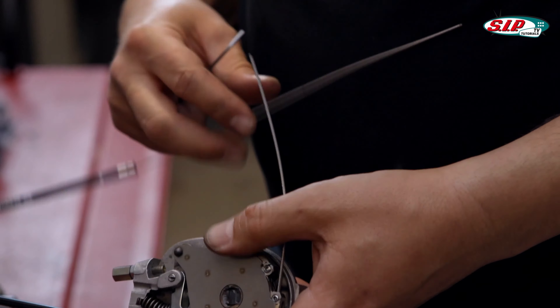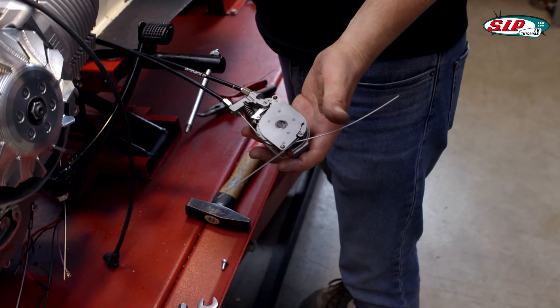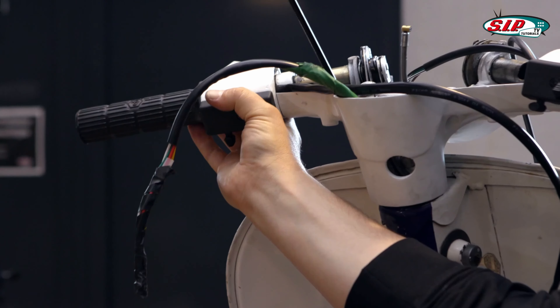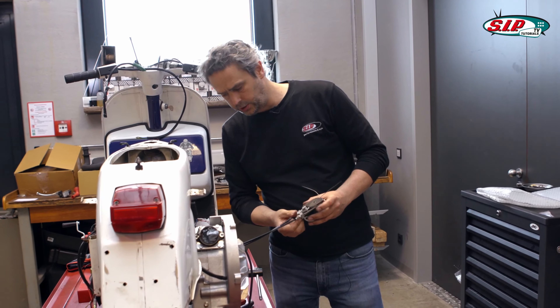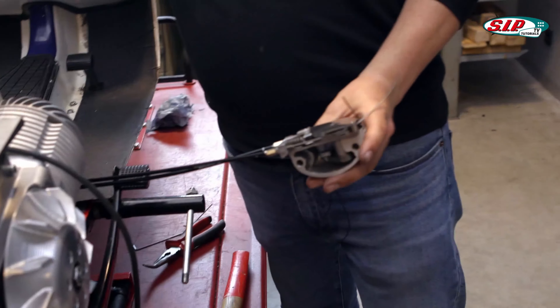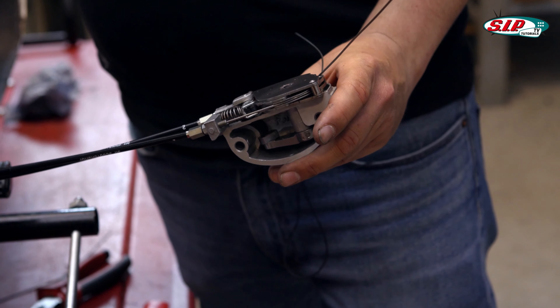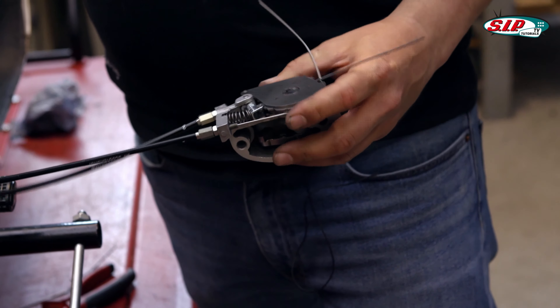I can shift the gear and it flips back to the top of the control handle. If I let go, it will go back to the starting position. It is important that it's always back in the starting position so it clears the way again. I have to adjust the cables a little bit here on the adjusting screws — they can't be too tight, they have to be a bit loose. Because it is very important that everything works as resistance-free as possible, otherwise it won't release the catch down here. Now it's pretty easy, but I'll still adjust it a little bit.